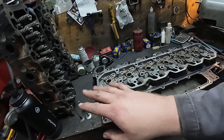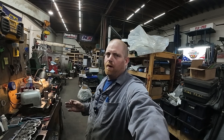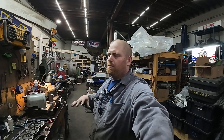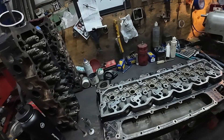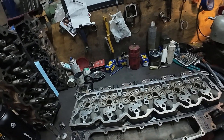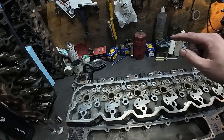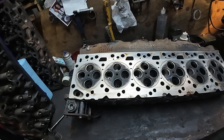I'm gonna omit some of the spring information because it's not as easy as just throwing these springs in there - there has to be some modification done. On this side it looks like just a regular generic cylinder head, other than we did put thread-in frost plugs here so they can't pop out. We did put a set of new guides in it last year.